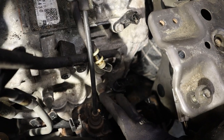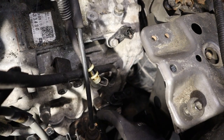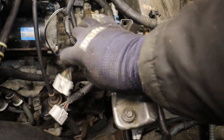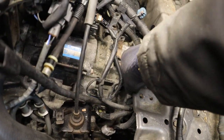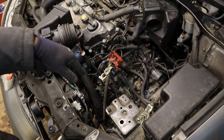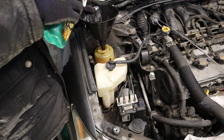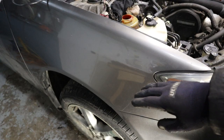The park neutral switch here has two elongated bolts so you can actually adjust it. If the car doesn't go into gear properly you can adjust it according to the position of the manual valve. I am going to reinstall the starter and run all the wiring harnesses — one goes down to the transmission solenoids, one goes to the park neutral switch, and one for the speed sensor. Before I put back the air intake I am going to start the car and move it back and forth to make sure the park neutral switch doesn't need any adjustment. I will also top off the transmission fluid and the power steering fluid — my Toyotas take ATF for power steering. I am going to bleed the power steering system by jacking up the front and turning the wheel side to side.